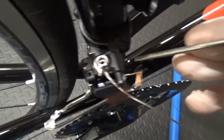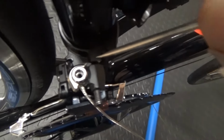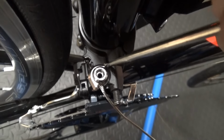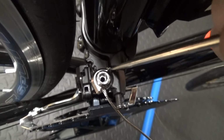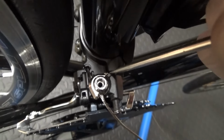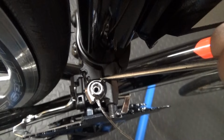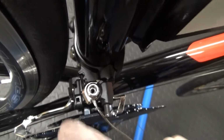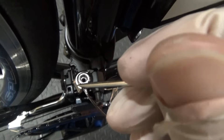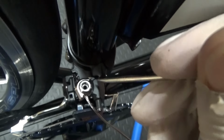Make sure that there's a little lug there, you see the back, that little grey lug, not the body of this, the next one over. Make sure that the outside of this is touching that, because obviously when you wind that screw in, that's what pushes on that lug, and it pushes round on the cable pinch bolt washer. It pushes it round, so therefore it tightens your cable up.